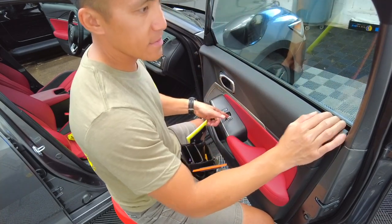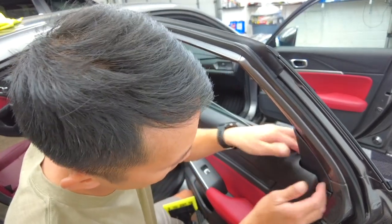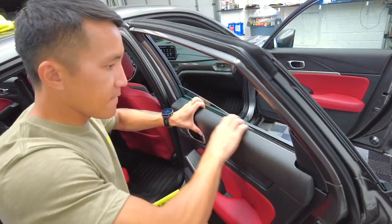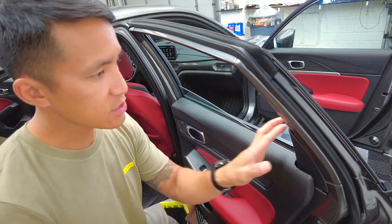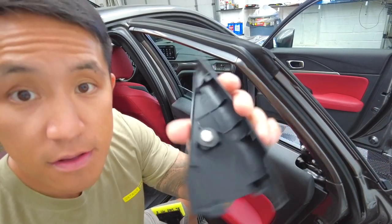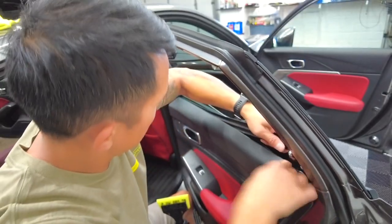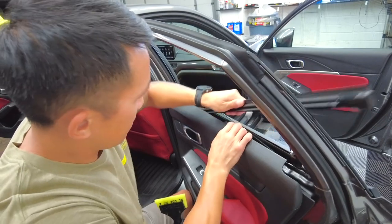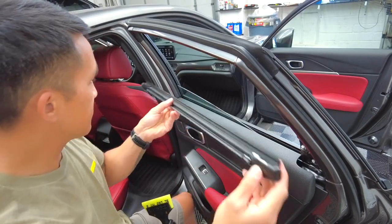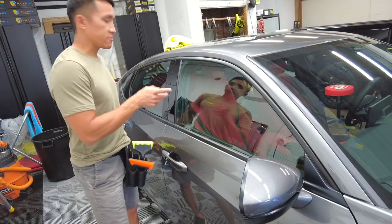Now we have an open bottom so we can bottom load. For the rear it's pretty much the same thing. I'm grabbing the plastic — it's pretty light plastic on the Integra. You reach around the side, follow it around, and it's got a single clip there, so that frees it. Just lift it up and pull it out. Same orientation: front to the front, felt to the exterior, drop it down.